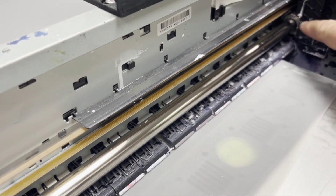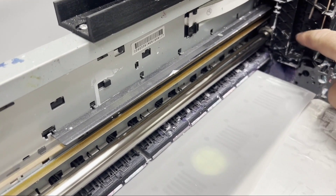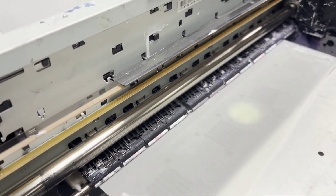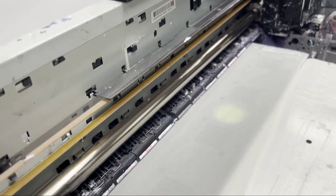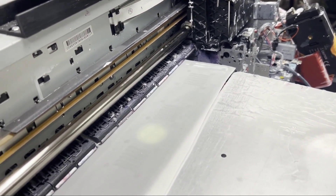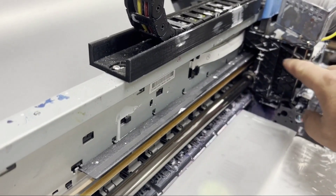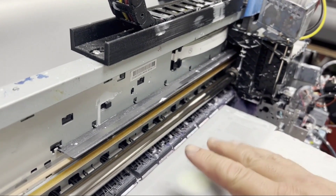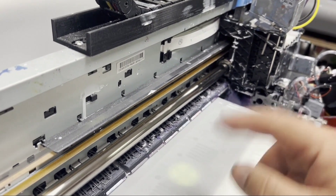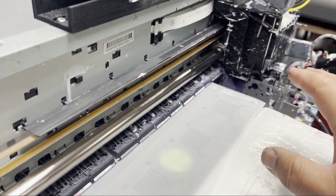The actual problem is that the printer carriage is moving on the rail and your rail needs to be greased. You might say, 'But when I move the carriage by hand it feels really smooth.' The thing is, the carriage moves at high speed during printing and the printer measures that speed — so if the speed is even a little bit off, it's going to error out.